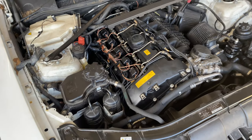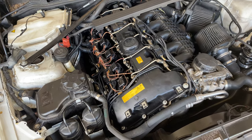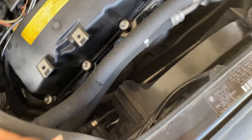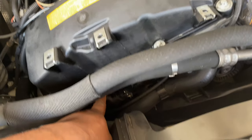For the first start, the car started, moved forward, and went into reverse, so everything is good transmission-wise. The only thing is it's complaining about a misfire on cylinder six and the vanos solenoid for the exhaust side - that would be the bottom one. So I'm going to go ahead and replace it and see what happens.